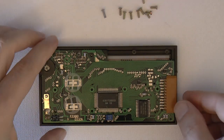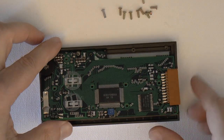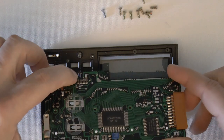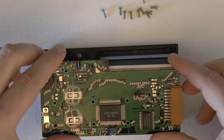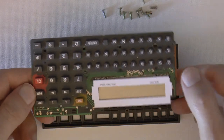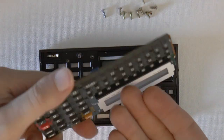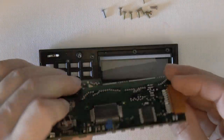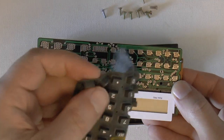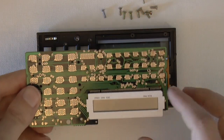What we need to do is lift the PCB out, which we can do pretty easily — lift it from the front and gently pull it out. There's a hole in here for the spring that it may catch on, so be careful. When we lift it out and turn it upside down, the LCD will sometimes stick to the PCB, so make sure you keep the old LCD oriented as it should be. You can now remove the rubber keyboard.